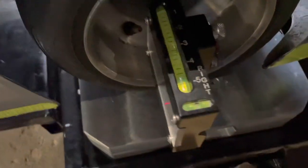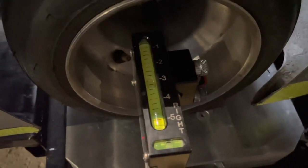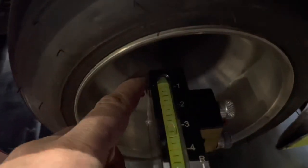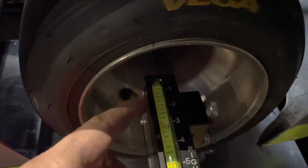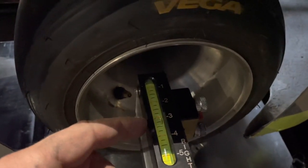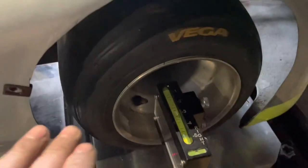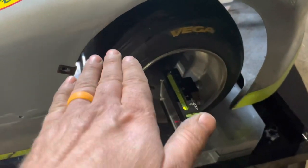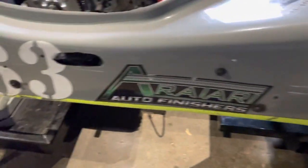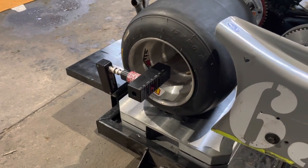Come up front here. This is not correct for what I was running — I changed tires, and you've got to scale with the set of tires you're going to run. So this is your negative camber: negative one, negative two, two and a half. Usually manufacturers are calling for anything from 2.5 to 3, even 3.25. If you're running a champ or something like that, sometimes they're higher because the chassis needs a little help rotating. So your tire is tilted — that works really well. The AccuToe is super simple to use, a little on the expensive side but well worth it if you're looking to get a good baseline for your car.